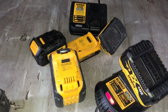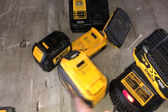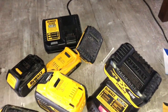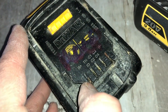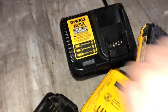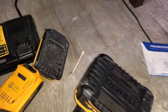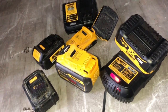The 60-volt battery does come with a little red cover, but who's really going to put a cover on their battery every time? Nobody does. So if you're not getting contact, clean these little prongs right here — they're probably just dirty and dusty. You could also take some sandpaper and sand the charger prongs if they're really rusted, but these look pretty good. If this video helped you out, give me a thumbs up.